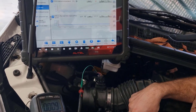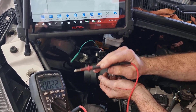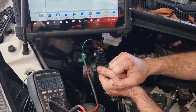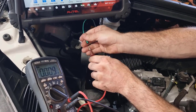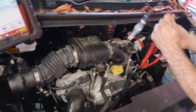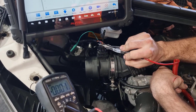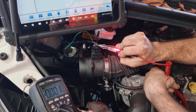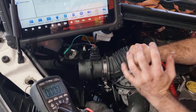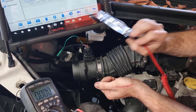I'm happy with the 12 volts over the other side — I've looked at that. This wire here — if we were really lucky, you might see ghost voltage. You'll see as I wave my lead around, we're seeing a voltage there. A nice way to tell that you're in a true earth is you'll often see this stabilise and you won't get ghost voltage. I'm not particularly confident with that on this one — there still could be a little bit of doubt. So all I'm going to do is take my test light and go off negative onto battery positive. If I've got a good earth there, we should light up. Putting some load through the circuit with the ignition on — the fact that we had a voltage drop test going on through there and we were close to zero volts is pretty good evidence that we've got a good earth. If you want to double up, put a bit more load through there — I'm confident there's definitely nothing going on there.